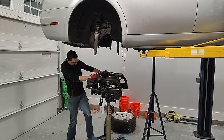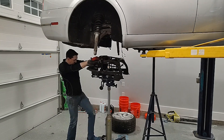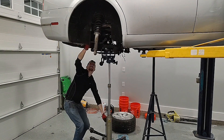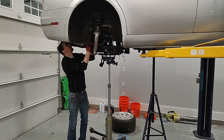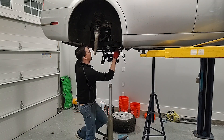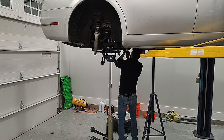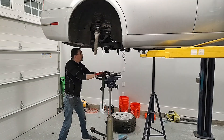While I'm putting the rear subframe back on the vehicle, let's touch on a couple of key points of using a transaxle. One is weight distribution — getting more of the weight over the back of the car rather than the front, which helps with cornering and braking. Another thing this transaxle gives me is that it already has a limited-slip differential from the factory, so I don't have to figure out any aftermarket options for the Scion rear diff. It's also going to be a bit heavier duty and will allow me to use heavier duty axles to handle the weight and loads this car will experience.